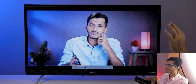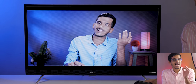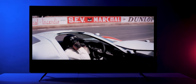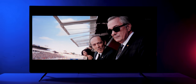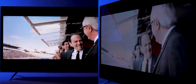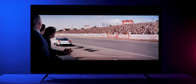Not just sound — the blacks on this TV are impressive. This is an 18:9 video on a 16:9 TV, so you get black bars, but those blacks look very, very deep. That's because of the VA panel. VA panels have better blacks and better contrast compared to IPS panels, though the viewing angles aren't as wide. If you view from an extreme angle, there is a color shift, but straight on it looks great.